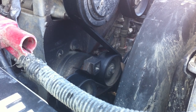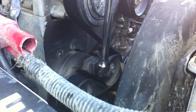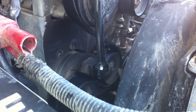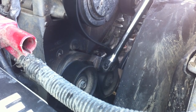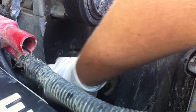Now is a really great time to consider replacing your serpentine belt if you haven't done so already, because in most situations you are going to have to take it off to do this service. What you're going to have to do is take a half-inch drive breaker bar, slip it right in here on the belt tensioner, and pull. Slip the belt off the idler pulley, and then slowly release the breaker bar — because if not, it's going to go flying and take your arm and your head with it. Take the belt off. You're probably not going to be able to get the belt off yet, and I'll show you why.